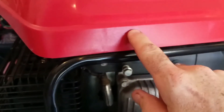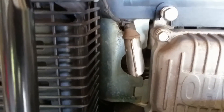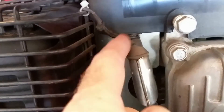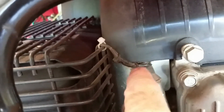And here's where the fun happens. In order to put this on, you do have to take off the cover — undo the screws here and get this cover off. You can just follow the instructions on changing the spark plug. The way this hour meter works, it just counts on time by measuring the voltage when the spark plug's firing. So whenever the spark plug is firing, this wire — which is the one we routed back from the unit — is wrapped around the spark plug cable and then just zip-tied on.